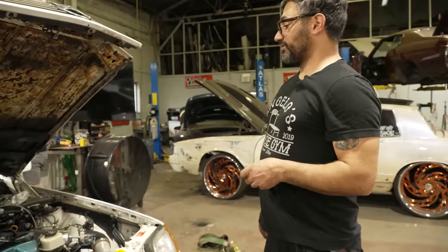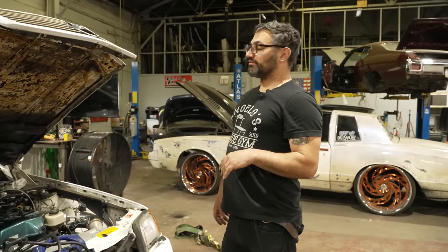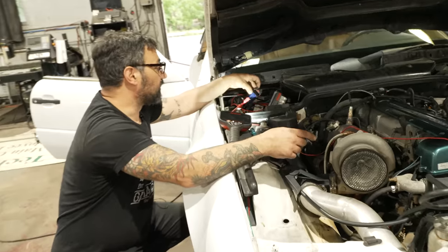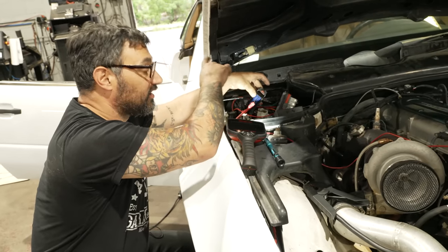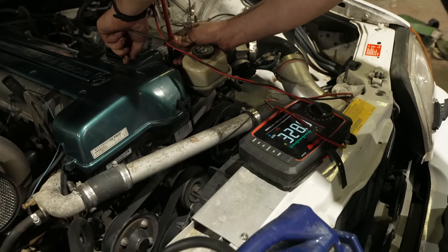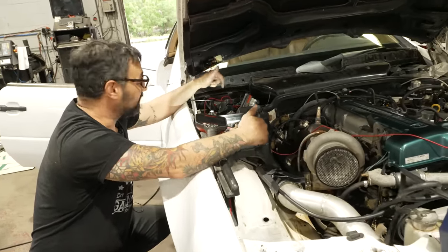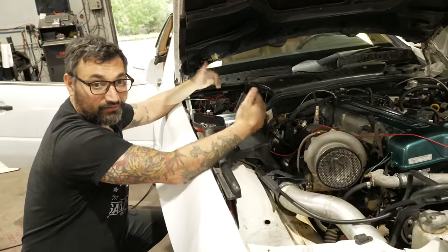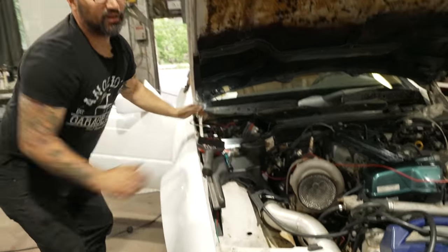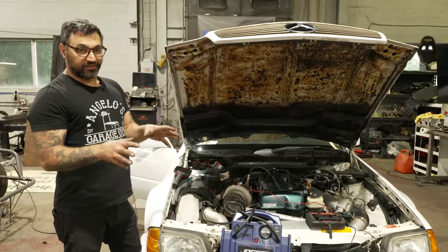That and I blew the front seal out of the engine from crankcase pressure. Shut her down. So I don't love it. All right, so we checked and these wires are unbroken from the computer to the injector connector. So we know this computer is having problems. That's the smoking gun. And we've got to send it back and get it fixed up and then we should be in business. So, just knowing that it wasn't running right, with it running badly, we tried to figure out what the problem was.